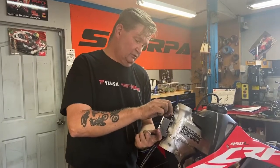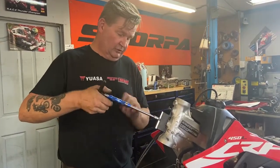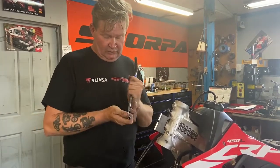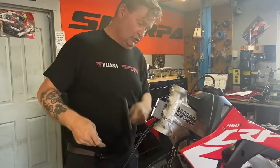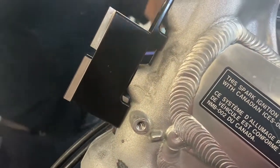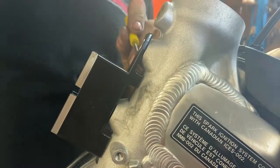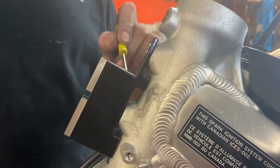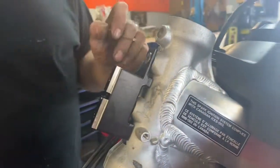The reason I've done that is for longevity. If you left this ridge in and left the powder coat on, they would wear into each other and the bolts would loosen up over time simply because this would be moving and rattling — it's not as if this lives on a nice smooth interstate. With a little bit of fiddling — maybe half an hour of getting things ready — now when this is just snugged up, you can see there are no gaps between the frame. It's over three quarters contacting the frame, whereas before it was just a ridge of the powder coat touching the casting seam. If you know how casting works, that's where the two halves of the sand cast came together.